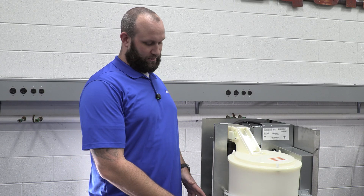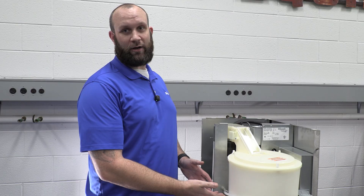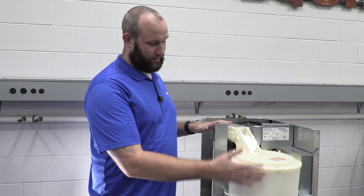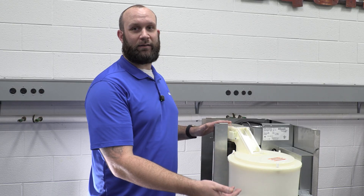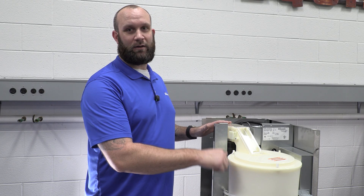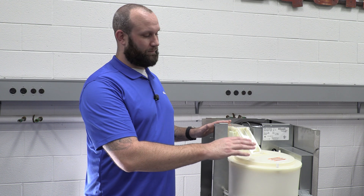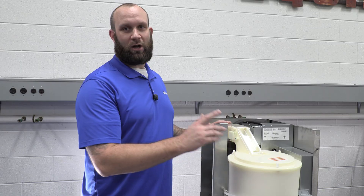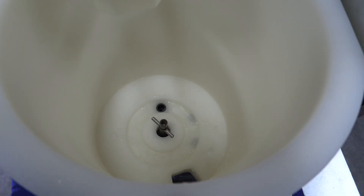That's not the case today. Unfortunately we didn't find a clog or restriction in the easy-to-access drain hose coming out of the bottom of the storage bin. At this point we're going to have to completely disassemble the bin and gain access to the fitting from the inside. We have another video that goes over the full step-by-step disassembly. I disassembled everything out of the bin and found we had a restriction at the drain outlet.